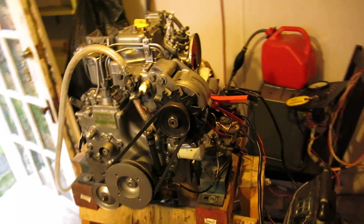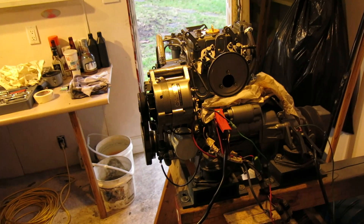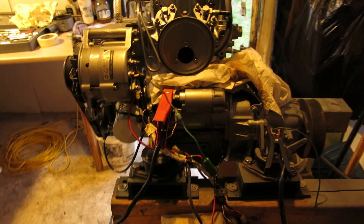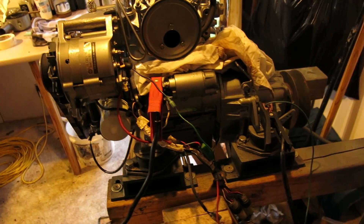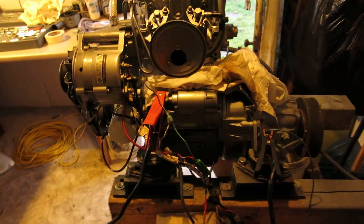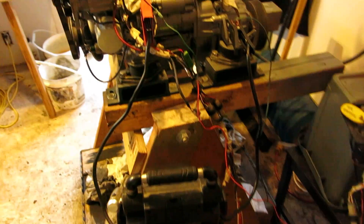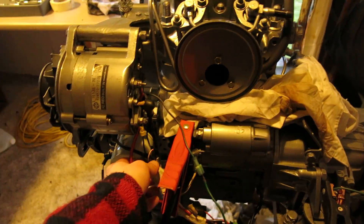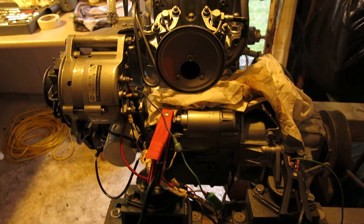What we're going to do is a cold start. There's a little heater there - it's saying it's nine degrees in here right now. There's a bit of a jimmy-rigged electronics setup for the instrument panel. When I ran it up for the first couple of hours I didn't have the instrument panel hooked up - just kicked it over with a booster pack to start it. These things don't need electricity to run, so I put a couple hours on it that way. I wanted to see how the instrument panel works so I hooked it all up - it looks like garbage right now, but the plan is to reroute all the wiring and clean it up once I put a couple more hours on the engine.